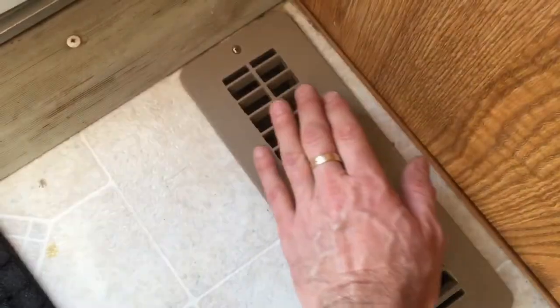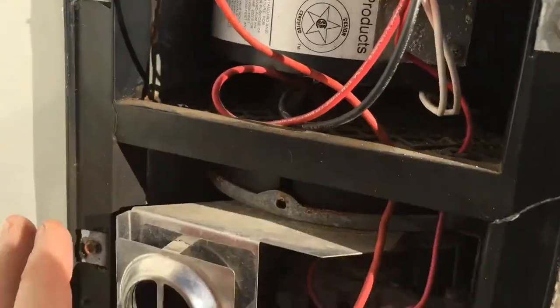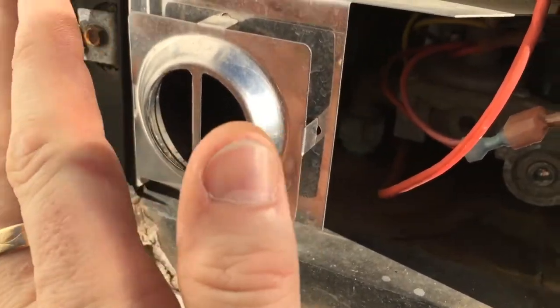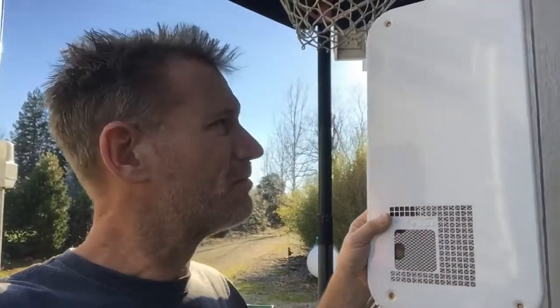Just a quick note: when I first got this camper it kind of freaked me out, but once you turn the heat off — or if you're just testing the fan without the gas going — once you turn the fan off, it continues to run for about 30 seconds to a minute. So just flip it off and give it some time. Don't keep fiddling with it. As long as the temperature is set down far enough, that fan will go off after about 30 seconds.